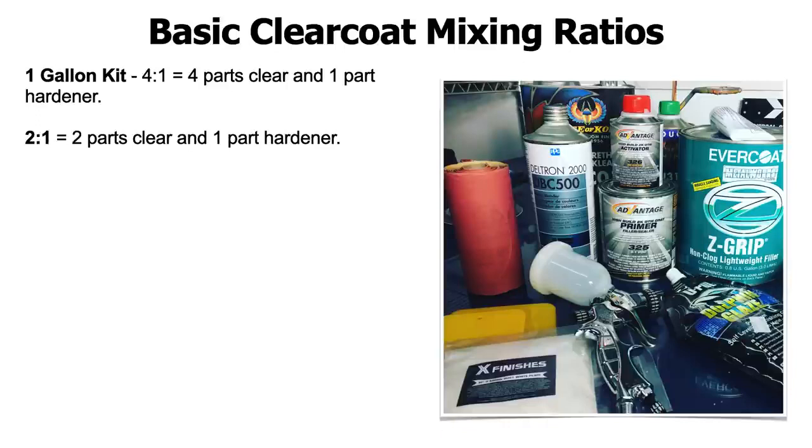You're going to see 2-to-1. Again, this all depends on what clears you end up getting, what your budget is, high solids, low solids, it all depends. This is a whole other slideshow and video on its own, which we could do in the future. Let me know, comment below if you like these videos. We could do something like that next. So 2-to-1 is basically 2 parts clear and 1 part hardener. If you get a gallon kit, you're going to get a gallon and 2 quarts of hardener. If you mix a half a gallon, that's 2 parts, then you're going to put 1 part, which is 1 quart of hardener. So you're going to have 2 quarts of clear and 1 quart of hardener, which is going to give you 3 quarts of sprayable material if you mixed half of what you got.